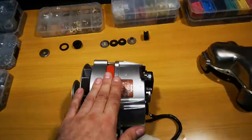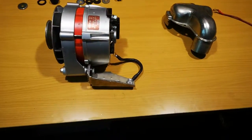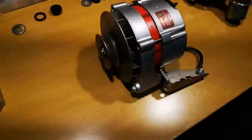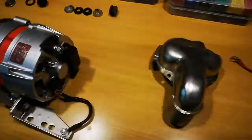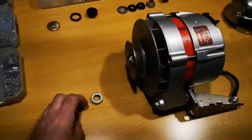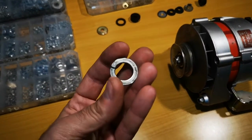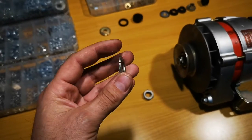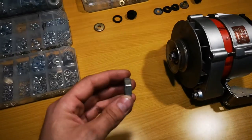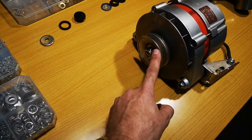This unit has been tested, taken apart, tested, obviously painted — and one of the things that I changed is I replaced the standard spring washer, because after zinc plating it's not spring loaded anymore, so instead I went with the nylon locking washer.